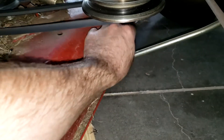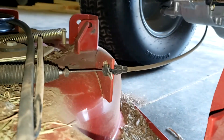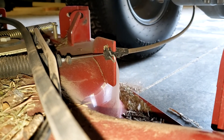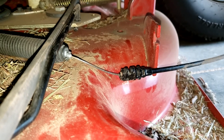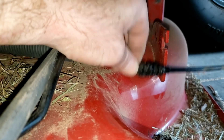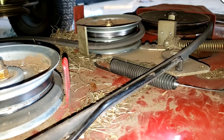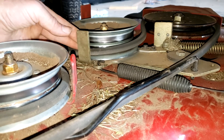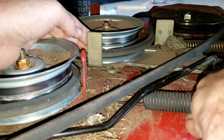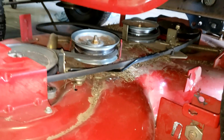Back to the left side — and I should remind you, don't lose those cotter pins. Just like before, I've got this little pin here; I'm going to use a screwdriver to pry that out and then pull the cable out of the bracket. What I did was pull with my left hand on the spring in that direction, then pull the cable straight back through the bracket, and the cable came right out. The easiest way to get the spring out is to pull it as far as you can one way, giving yourself plenty of room to pull it free. Now the deck is completely disconnected and I can pull it straight out.